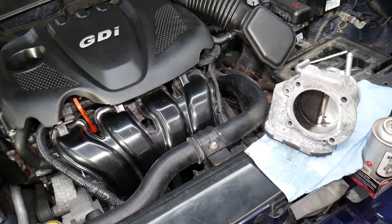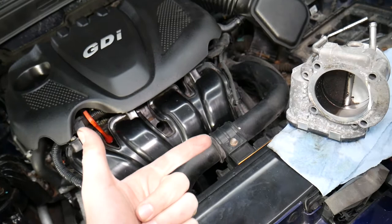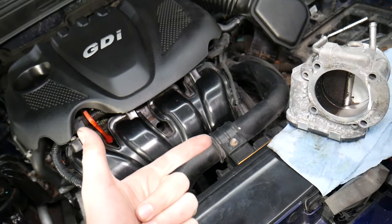If you have the engine light on — such as misfires or a fuel injector not working — that will be the reason for your unstable operation. But if everything else checks out fine and you don't have an engine light, always check for a dirty throttle body and leaking gaskets. Hopefully the video was helpful. Thank you for watching and see you guys next time.